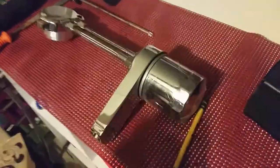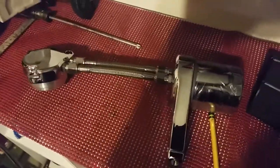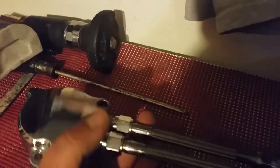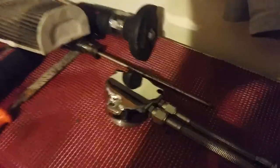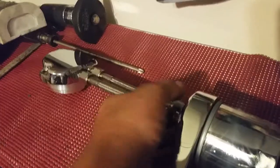I also have this going on — this is an oil filter relocation kit. This is not for the Yamaha Virago; it's for the Star 650 or whatever it is. The bolt pattern on the filter took the same filter as mine, so this will bolt in its place. But there's a little piece of aluminum that has to be cut back on the side cover, so I'll be doing a video on how I did that when I install this. I also need to order some longer oil lines.